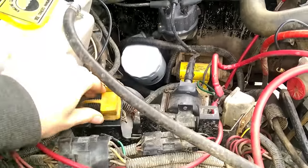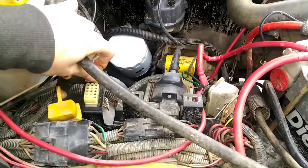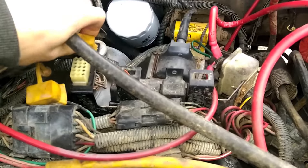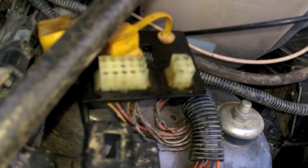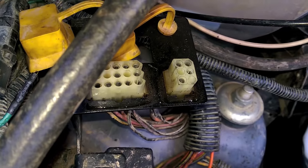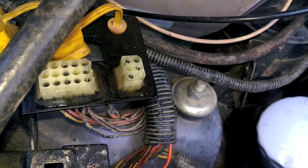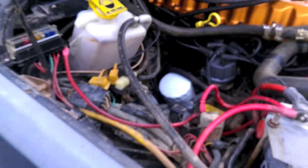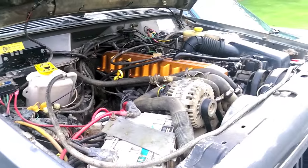Under these little yellow caps you might have an entire plastic tray, but you take the tray off and take these caps off and you've got two diagnostic ports here. The larger one to the left is for the ECU and the smaller one to the right is for the transmission. So obviously if you have a manual transmission that second port isn't really going to do you much.